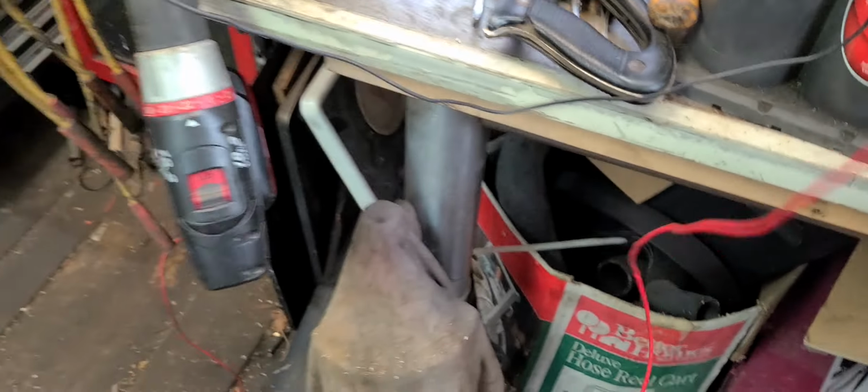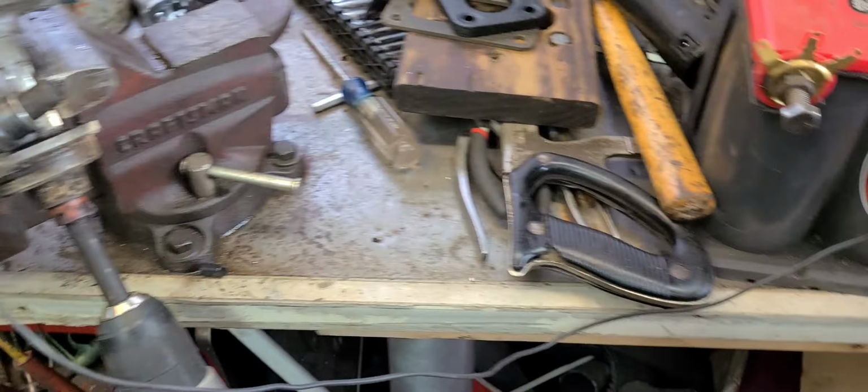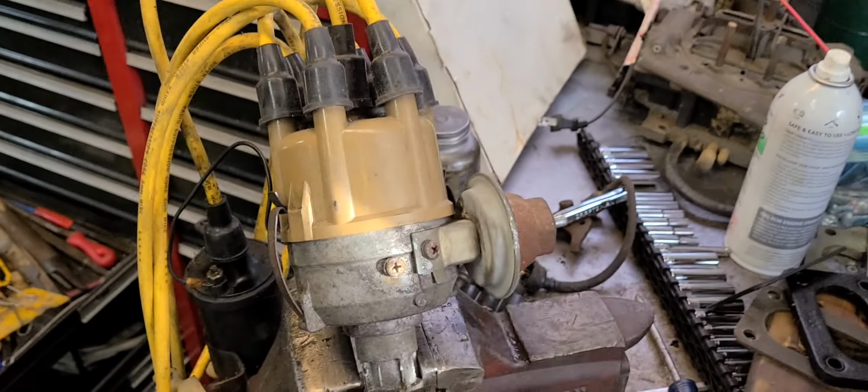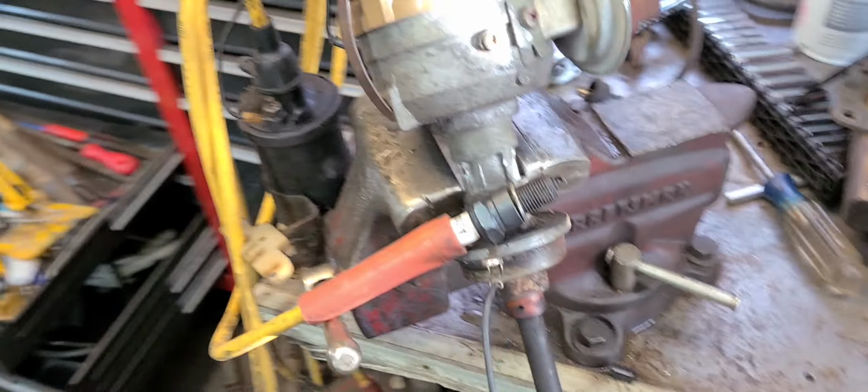See, that's another indication that your coil is good and your points and your condenser are good. Okay. Now the points, I sanded them and I set them, sorry about that, I got a little dust in my throat, but I set them to 16 thousandths. Okay. So